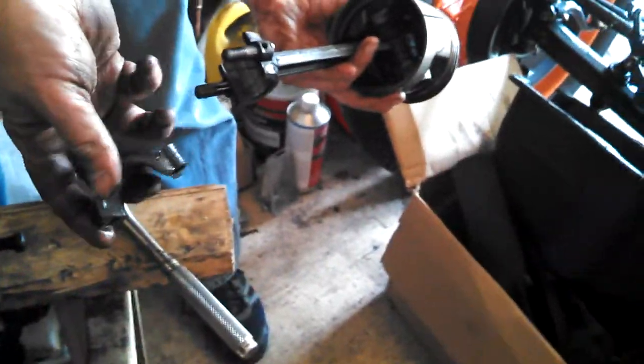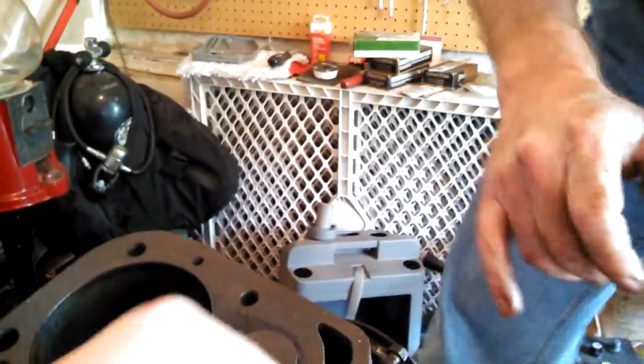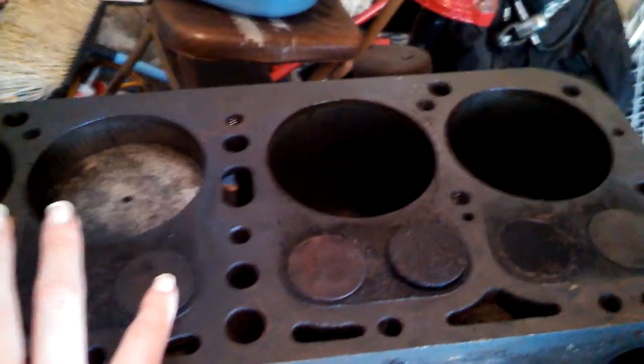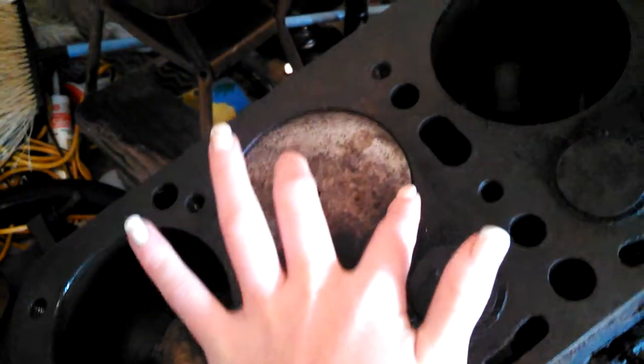See how that's got a mark on it — it's got two marks. This side has the mark and this side doesn't, so you know this is number two piston, which is the position we just took it out of. This engine has cylinders one, two, three, four. These are the intakes — the ones closer to the back are the intakes. Now we're on the compression stroke on number three. Boom — the piston goes down. As it comes back up on the exhaust stroke, it pushes the exhaust back out. This position — all the way at the top — is called top dead center.